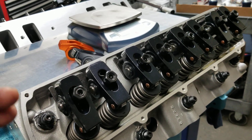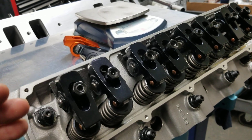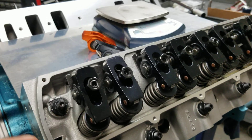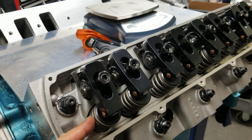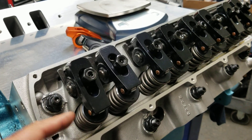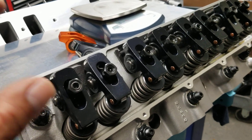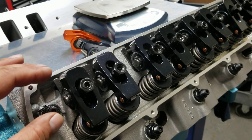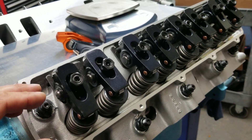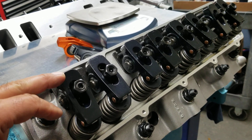We've got a super strong rocker arm that's significantly lighter than what's used in the industry. That's going to save you quite a bit in spring life — it will basically double your spring life — which is a great thing. It's not too cumbersome and works excellent. Another feature built into these Black Widows is oil restriction.